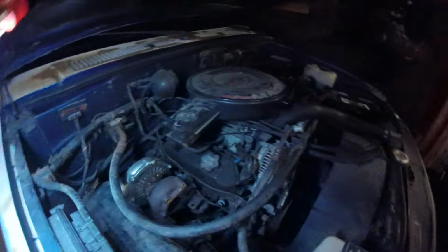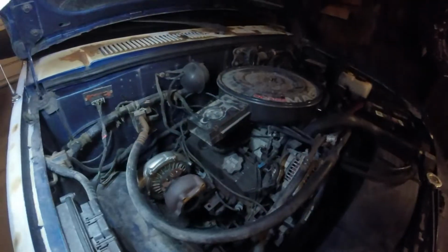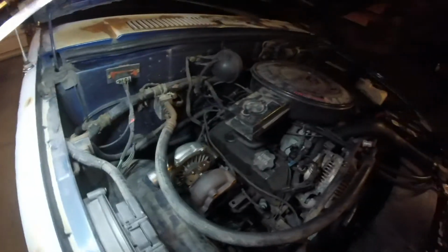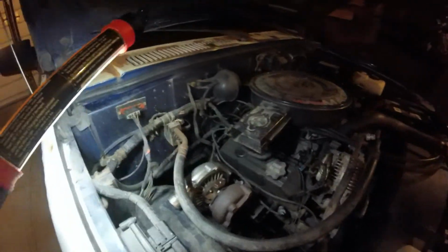And the next thing is the exhaust. This is what I mentioned in the last video I released, the 1000 subs video, where I was talking about the Subaru rumble. So in the engine bay, I have a turbo actually sitting in there. Right here is where the turbo is going to be mounted. I'm going to take the stock cast manifold, weld a turbo flange to it, and basically right there is about where it's going to sit. Of course, it's going to be up closer to the valve cover and not resting on this fender. But this is where the turbo is going to sit.